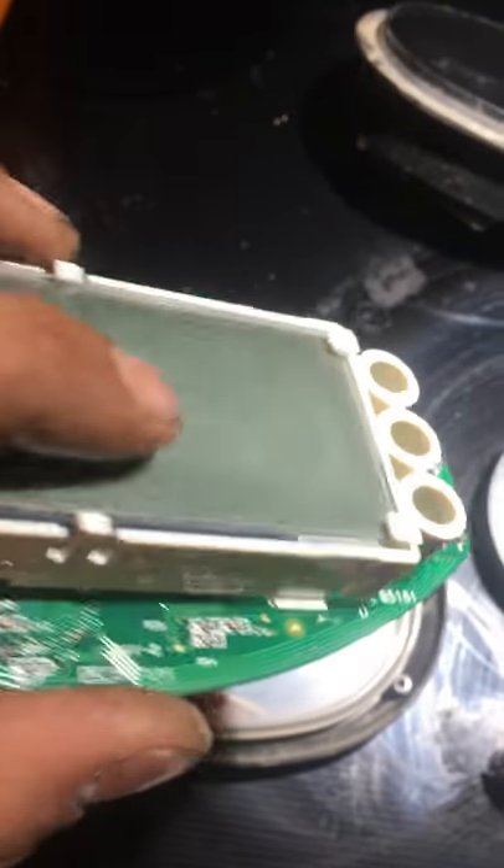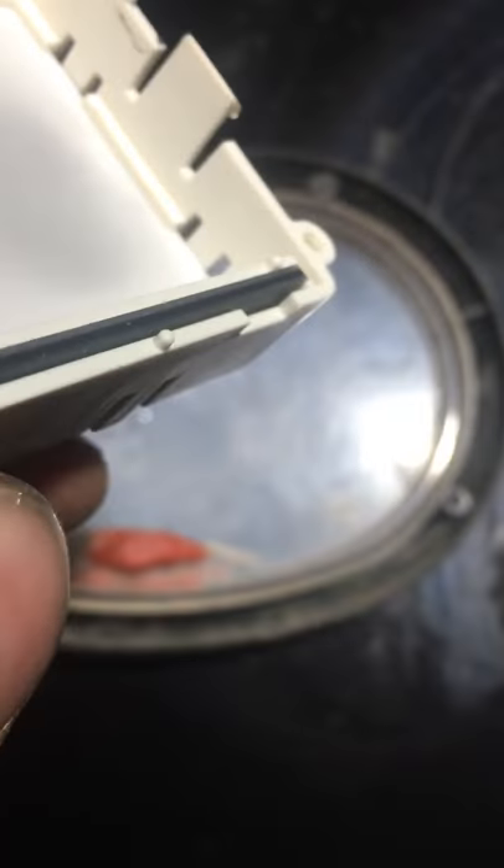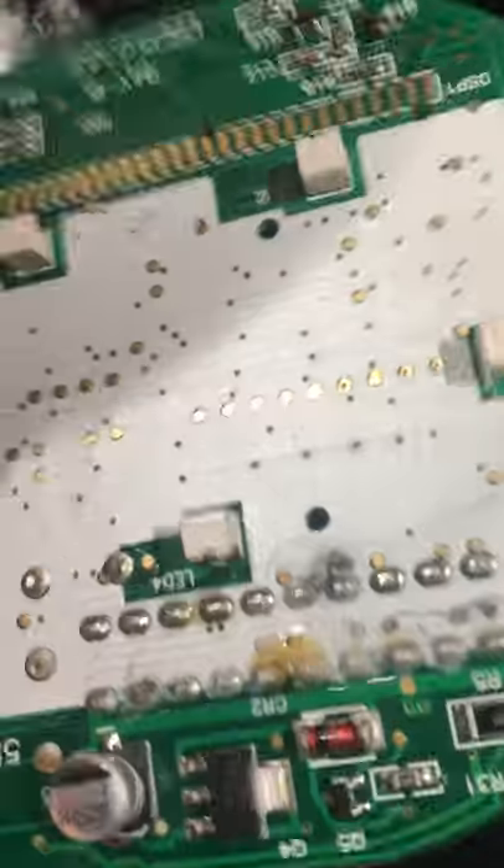You pop this over and you get the front side of your screen. You've got your chip on the front side. This little black plastic piece pops out here and you're left with the screen. You might be thinking how the heck you're gonna get that off — well, if you look at these little tabs in here, just push the tabs very gently and then you have your screen and your inner chip. That connects right here along this — it's like a rubber tether that runs along and connects there.